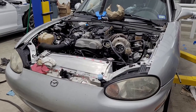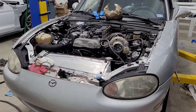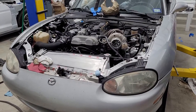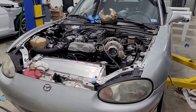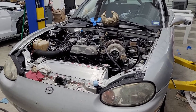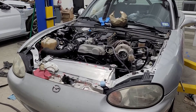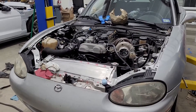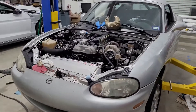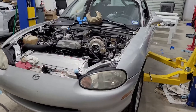However, once the pump shuts off, the oil returning to the valve cover would slowly gravity drain back through the pump. You could drive the car and come back a few hours later and it'd be fine, but if you let it sit for a few days, that oil would slowly back-feed through the pump and fill the turbo up again. So I had to build essentially a reservoir underneath the turbo using tubing routed back and forth — a small gravity-drain reservoir between the pump and the turbo.